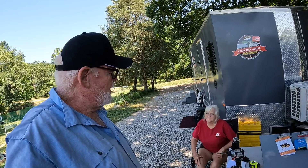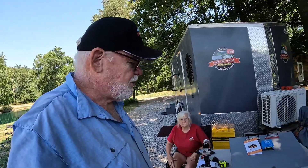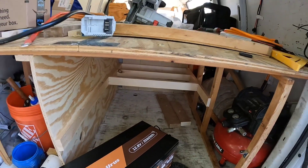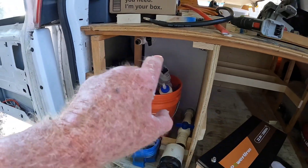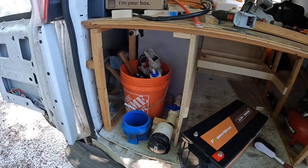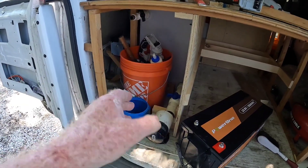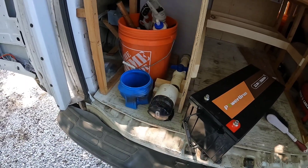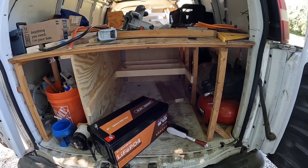We have been working on a project. I need to start with what we did in the back of the van. You see this tank sitting back there — that is our auxiliary gray tank where we can pump the gray water off of the trailer into that tank and then simply drive to the dump station and hook up a regular three-inch sewer hose and go ahead and just dump it that way, rather than fighting with a blue boy and all that kind of stuff.